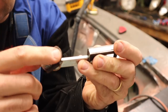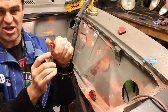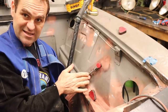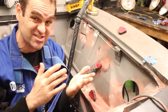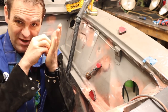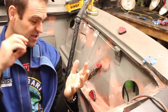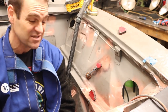And things like this hole here, a really good thing that I picked up to fill those is this little guy here. This is a copper plate that will sit behind the hole. And it's got a magnet on the other end and an adjustable screw head. So basically, I would stick it behind the hole, in this case, like that, and I can adjust how tight it sits onto the hole. And the weld doesn't stick to the copper, so I can stick it right behind. It gives a bit of a heat sink so that the metal won't just blast away, and I can weld up to it, and it'll give a nice flat surface on the back of the weld instead of the weld just pouring through. So I'm going to put this in behind and go through and fill in a few of these little holes.